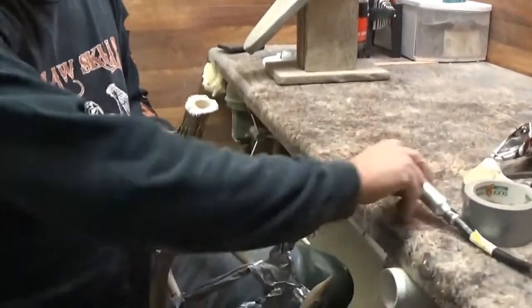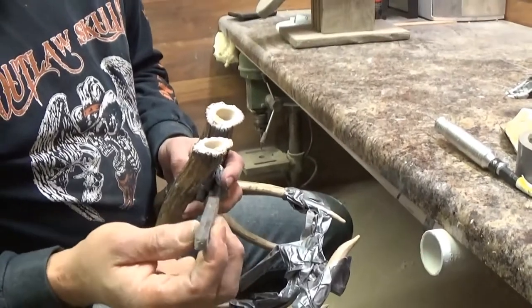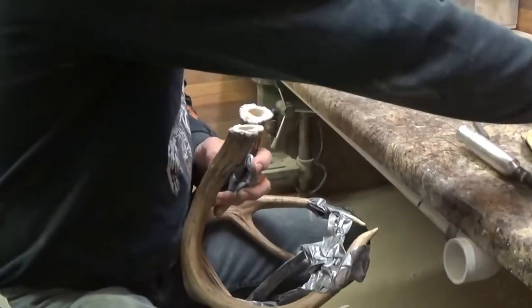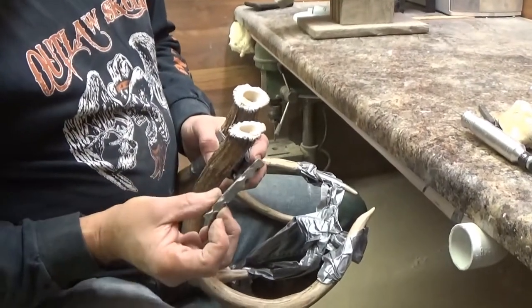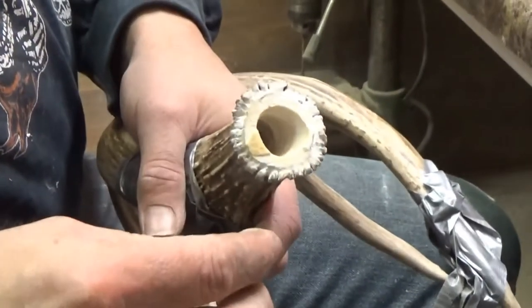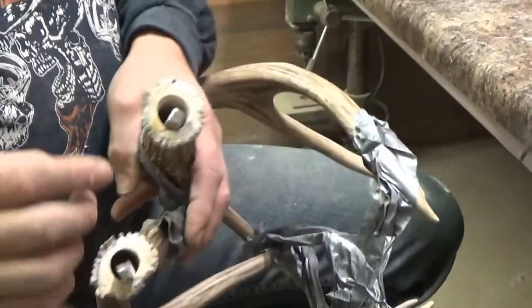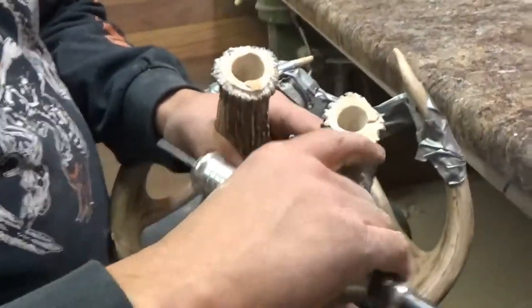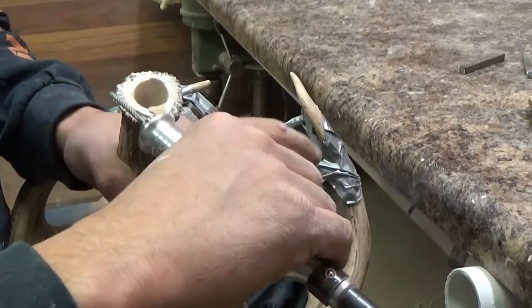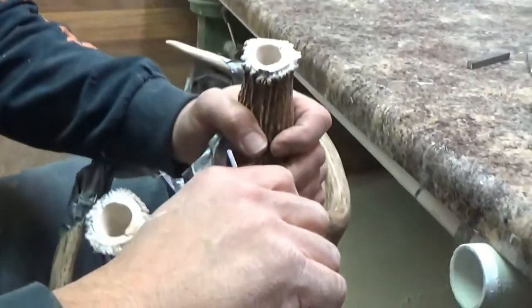All right, so once we've got the holes drilled out, the pins come with it, the square stock, and they come smooth. What I normally do is put them on the grinder and just cut the edges off of them. That makes sure that it grabs when you put the Bondo in. But just for reference, take the pins, stick them in, and make sure you've got some sticking out there. What I like to do is grind this out and make it angled so that it kind of fits over the pedicles also. It's less cleanup. So I'll show you how to do one of those.